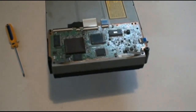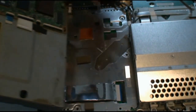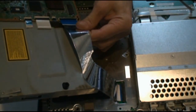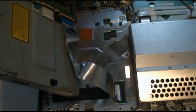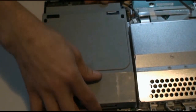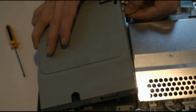Your drive is fully reassembled. Now you can go ahead and put it back in your console. Make sure the drive circuit board is facing you. It's easier if you just lay the drive down first so it's in place, then lift up on one side and plug your power cable on.